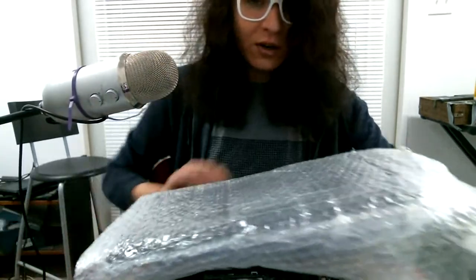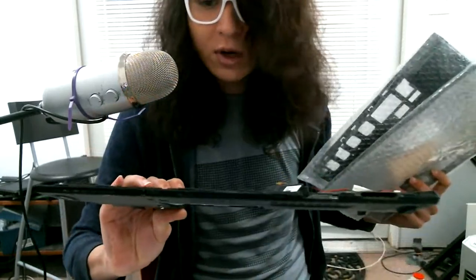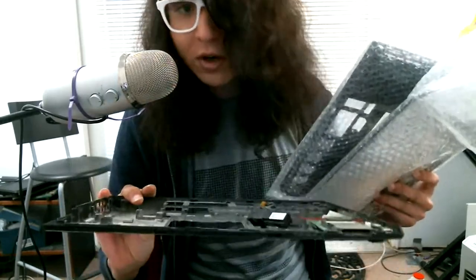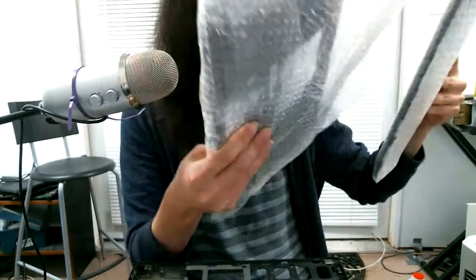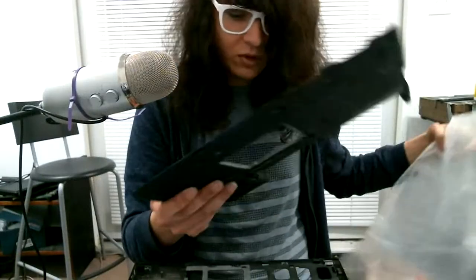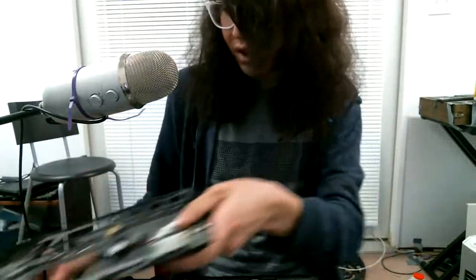But then we got our base plates. And this one is actually from an X201, I believe, that has a slightly different motherboard, and I didn't really feel like making the Dremel tool part of the live stream. So, we're going to use some actual proper X200 base plates, even though I do like using these screens from the X201 because they are pretty much always LED, unless someone's been doing some weird lid transplants. So let's see where the X200s are. That'd be a good idea.